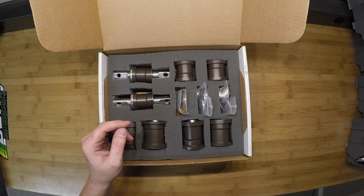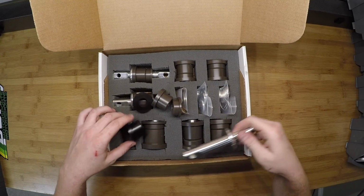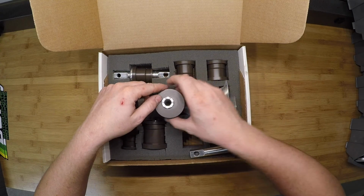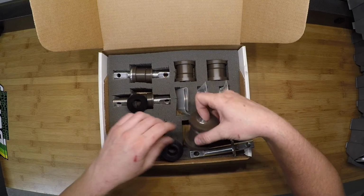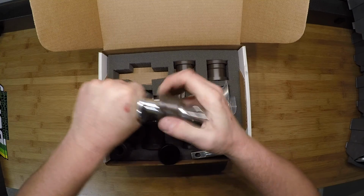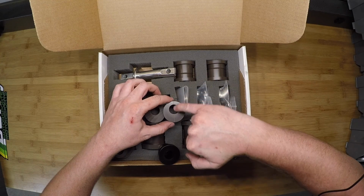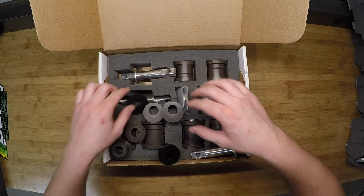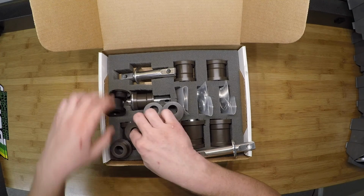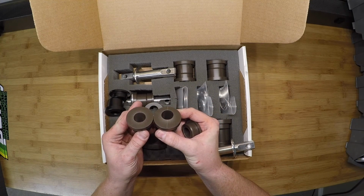Now if you're looking at the regular Delrin kit or the Delrin AF kit, you'll end up with some items that look like this. They're all identical dimensionally other than the offset that's machined into the bushings. So to compare, let's compare the dog bones in the front. So here's the front dog bone bushings. For the offset kit, you can see there's a line ground onto it to show the direction of the offset. That helps with lining them up on the control arm. Then we have the standard Delrin, which at this time is black, and the non-offset Delrin AF. You can see you get on the upper control arm, you get a couple tenths of an inch of offset there.